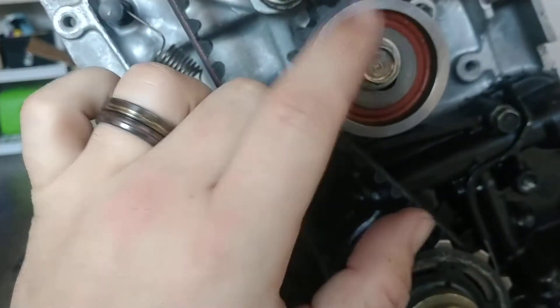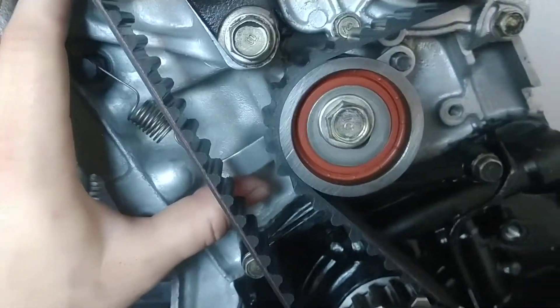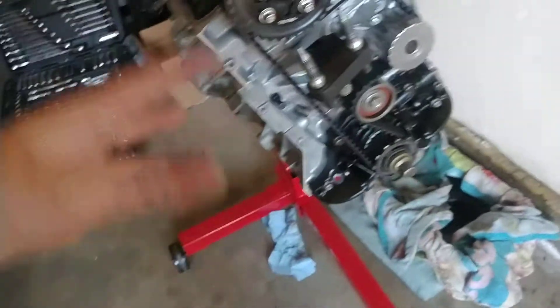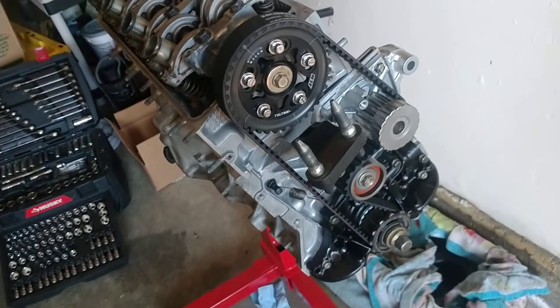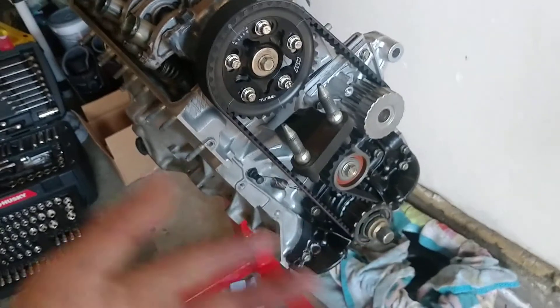The tensioner spring is what actually sets the tension on the belt. You'll need to torque down this adjustment bolt to 33 pound-feet. I gave mine a little extra tug to snug it up because this is not going to be facing factory power of 117 horsepower. That pretty much wraps up getting the belt on — this engine is timed. Once you do that, do a few rotations of the crank and make sure you don't hear any interactions between the valves and the pistons. If you do, take all the timing off, verify it's timed correctly, put it all back together, and test again.